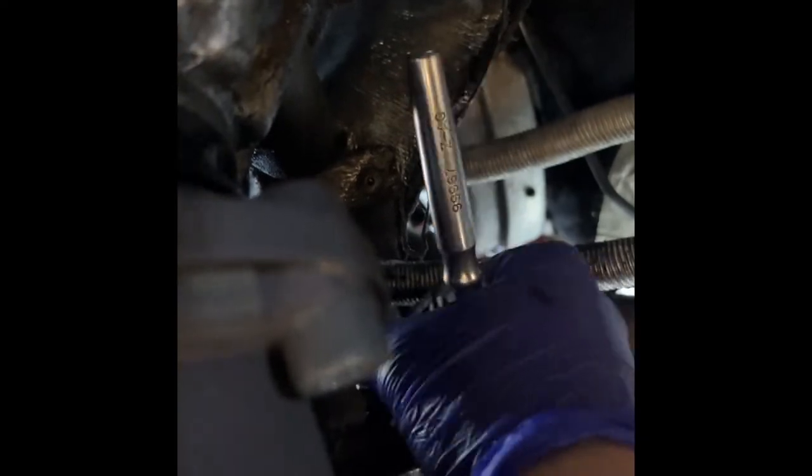Wear glasses or goggles because stuff is flying in my face — thankfully I have goggles and a headlamp on. You can see the bolt is almost out. Go ahead and remove it. Now that you've removed your 5mm bolt, if you're not someone who likes to yank on stuff, use a little flathead to pry it just a little bit.